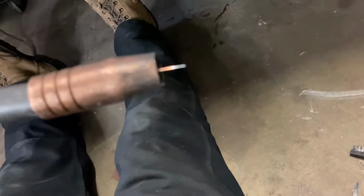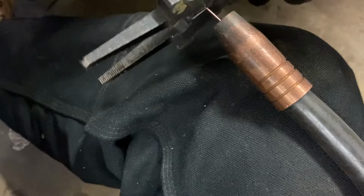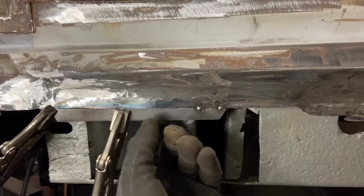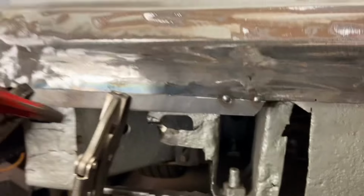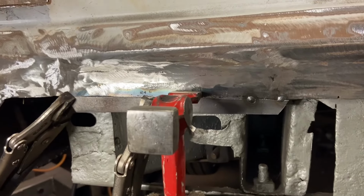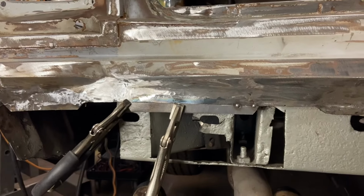I've always got my welpers, so this way I always try to start off a new weld with a fresh cut. For example, you see this blued out area here on the tip of the welding wire from the last weld. I like to start out with a new fresh snip. And then we continue along the way, holding it in place, working it as we need to. I gotta move it in to match it up. So this way we get a nice clean butt weld. I'll hold up here and push against as I weld. Just stuff like that, just to get nice clean work done.